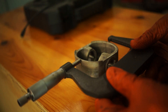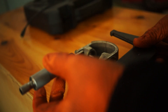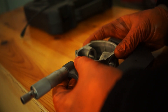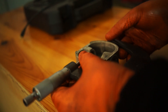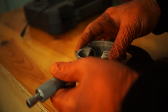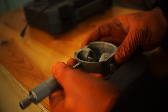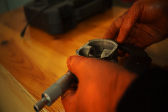Measuring the pistons is important for checking piston-to-wall clearance. I'm using a 75-to-100 micrometer to measure the pistons. You have to measure at the bottom of the piston, because the top of the piston is smaller — due to more heat at the top, the piston expands more there. So pistons are kind of cone-shaped, designed so that when they heat up they become cylindrical. That's why you measure at the bottom, which gives the full measurement — in my case, 81.00mm.